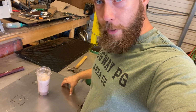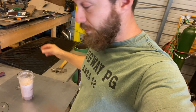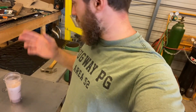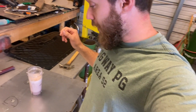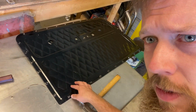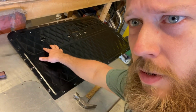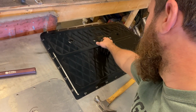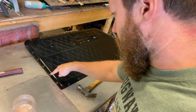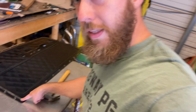So I'm gonna put the whole pattern out, and then I gotta lay out what goes when. Because you wanna do your cross hatch first, because it'll be flat, and everything's gonna curve. And you want that to be able to curve, because that's what gives you your pillow look. Then I gotta flatten it back over with my calibrated knee. And then from there, you'll do these, and then this edge right here on the top and the bottom, and this one, and that one, and that one, and this one, and then hit it with the planishing hammer here. And then you'll do the dimple die for these, and then this one. I think that's the order it goes.